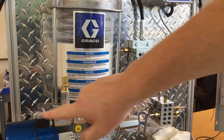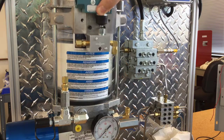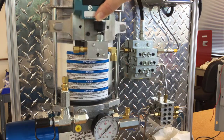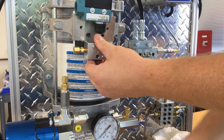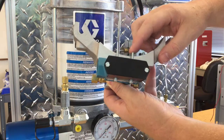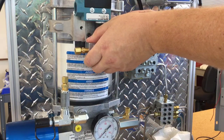Now we've got the fittings attached to the fill port, and we also have our new spud, nut, and fitting over here on the blowout assembly. The next question is where to mount our bracket. If you go low it's going to be a really tiny piece of tubing that will be hard to bend and get in there. On a 12-pound reservoir you're pretty much going to need to go all the way up to the top. Once in position, take your set screws and clamp them down with a one-eighth inch Allen wrench. One thing to note: these screws are actually a little bit too long — it would be a good idea to use an electrician's tool to trim the bolts shorter. I'm going to do that off camera and then reattach this as high as it can go.